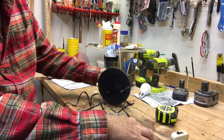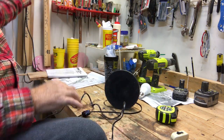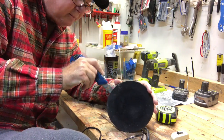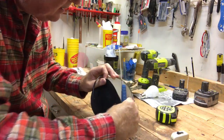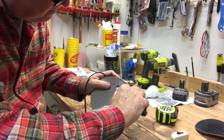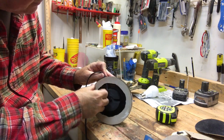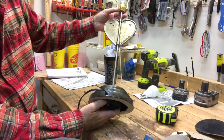Now we're just going to go to the bottom of the lamp and very gingerly take off the bottom housing. Sometimes you can do it with a screwdriver. We'll just see — this is like felt. So we'll just cut into this. You can see what we've got here. This cord comes into this pole and slides up, going all the way to the top of the switch.